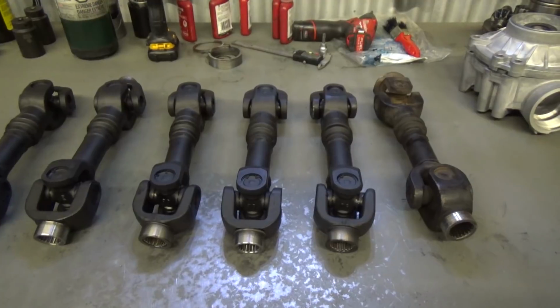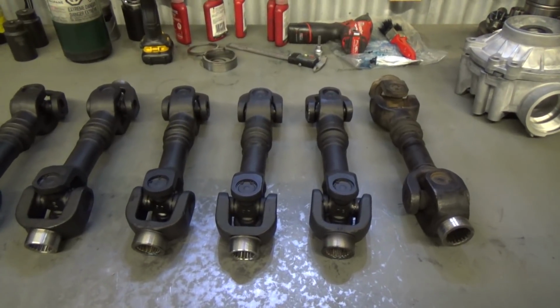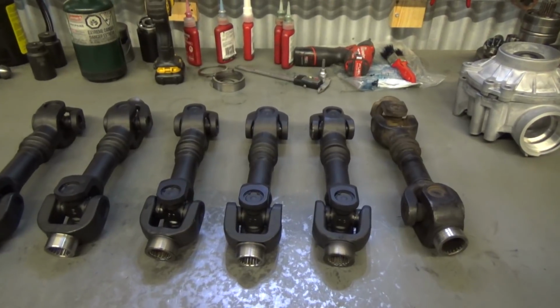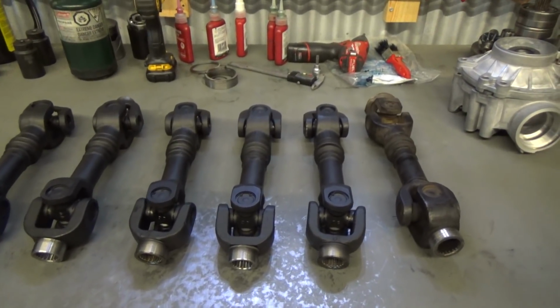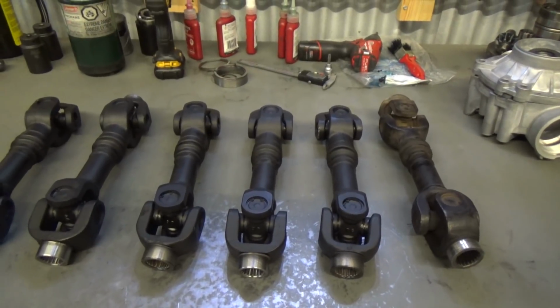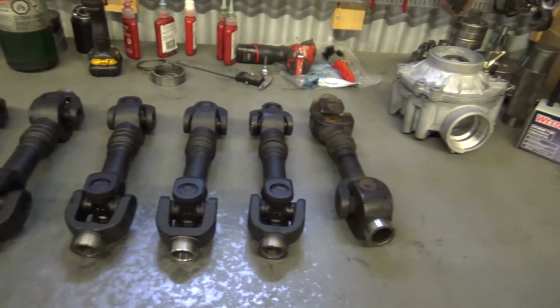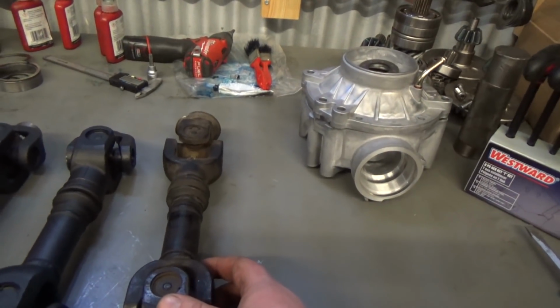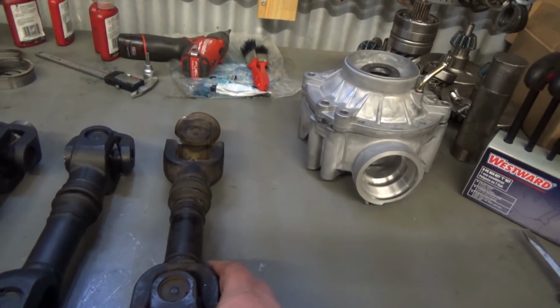So far, with the measurements I've done and from the prop shafts I've seen in person, those model years, the prop shafts have been out anywhere from 2 degrees all the way up to 6.5 degrees. Also, this is an XMR Renegade shaft here. It is out of phase. It also has a bend in it.